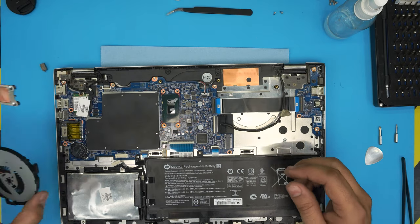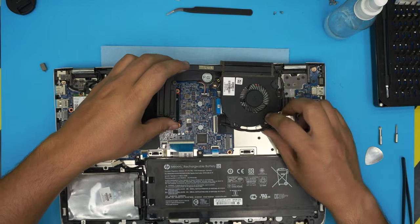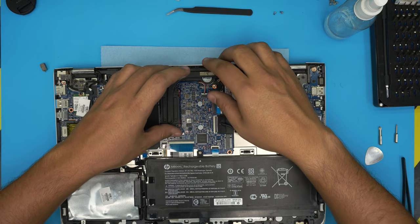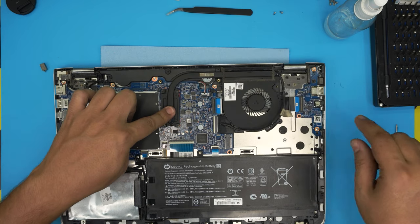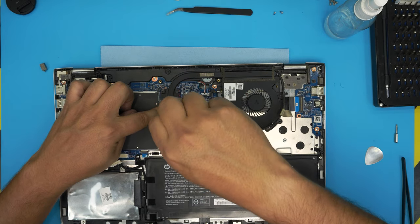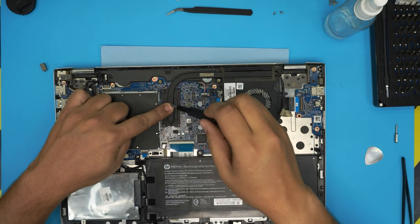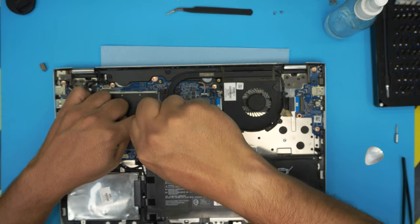All right, next is to grab the fan, put down the one under the cable right here, run the cable around it. Bring it over, align, and make sure it stays right there. Then grab your Phillips number 1, hold it down, and then screw them. Always cross screw them. So I did 2 and then 1. You can do 1, 2, 3, 4, or just cross screw them.